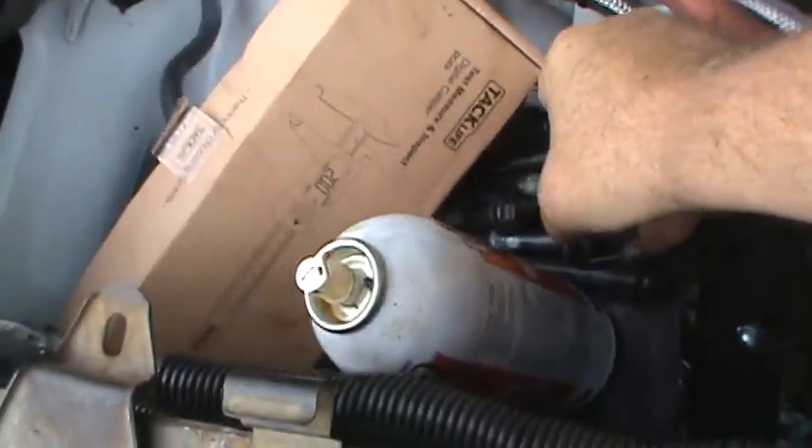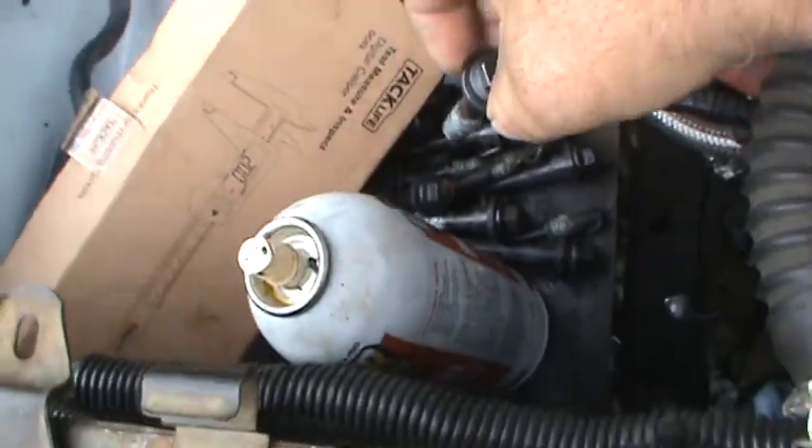Stay tuned - it's a learning process for me too, like I said I've never dealt with poly locks before. Let's see if we can get this valve train all set up properly and get her done. I've got a lot of cleaning to do - my ARP head bolts are quite dirty with old thread sealant on them. Plus I've got a new bottle of ARP assembly grease that you put under the flat washer and on the head of the bolts to get a true torque. Anyway, thumbs up for war amps, stay classy boys, more coming.